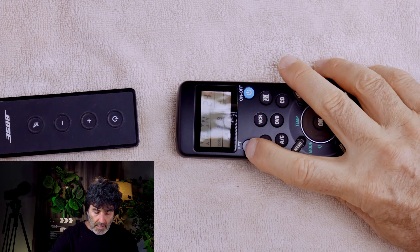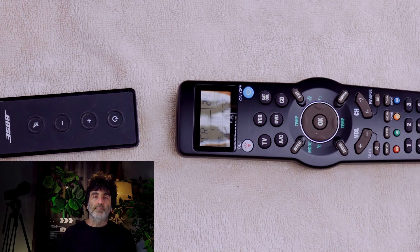Press Set, then exit to go back to normal. Now if you remember, on my Sharp TV I found that not all of the functions worked right. I tried to program just the ones that were missing, but that didn't work. I had to go through and program all the functions I wanted, including the ones that worked before, in order to get it to work right.